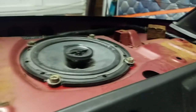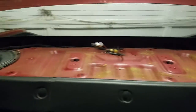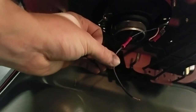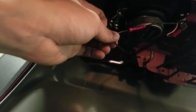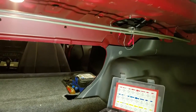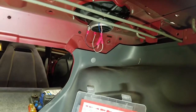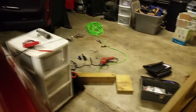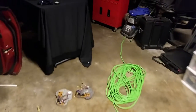Both rear speakers have been installed with that modification. Now I'm going to come underneath the speakers. I have already crimped and put the connector on the power wire, and now I just need to put a connector on the ground so we can go ahead and plug in our speaker to test it. The speakers on the passenger and driver's side of the vehicle on the rear deck have been wired up and are working perfectly fine. The last thing we are going to be wiring up is our subwoofer and the amp.